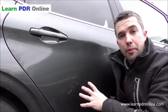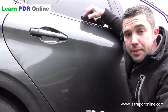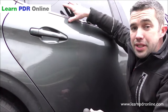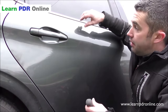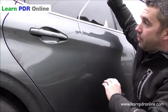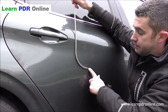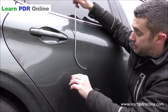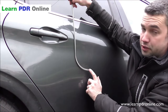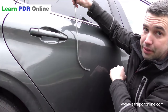Using this door panel as an example: we drop the window down, then with a window wedge open up the recess between the door skin and the glass, and put a window protector board against the glass to prevent scratches as we lever. Once the board and wedge are in place, we slot down our chosen dent repair tool on the inside of the panel, locate the dent using the lined reflector board, and then gently twist the handle to push out the dent from the inside. There are a variety of different lengths and shapes to allow you to reach different points around the door panel.